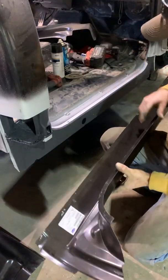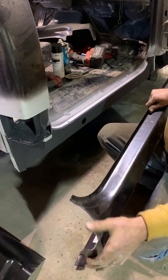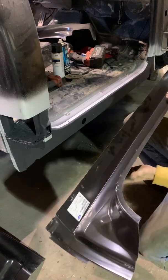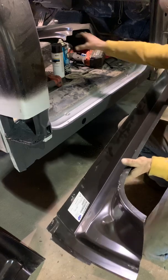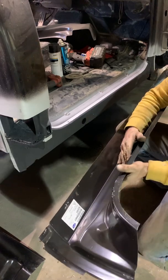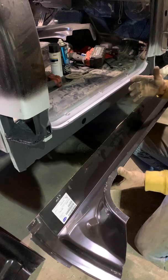So on these panels, once I get them prepped, I'll have to put my holes obviously in the bottom for my spot welds. There'll be spot welds here, and then here will be welded solid. What I like to do is I take these tags off because they're not going to stay on there forever, so then you have no protection underneath there. Because I like to take and scuff all this up on the inside, just a little bit of something for this to stick to. Since this is kind of like a galvanized, I like to spray this on the back side of my replacement piece, give it a little something extra, and once it's dried up, I will spray it down with undercoat and give it a little more. Say some of this is going to burn out. So something's better than nothing is the way I look at it.